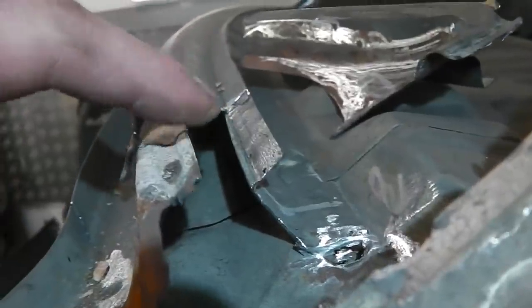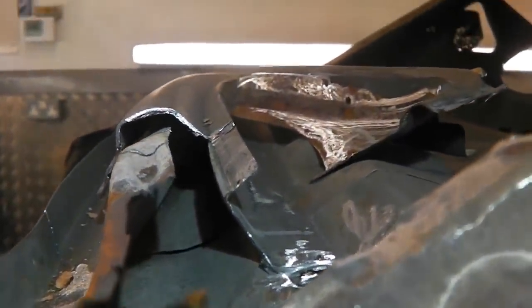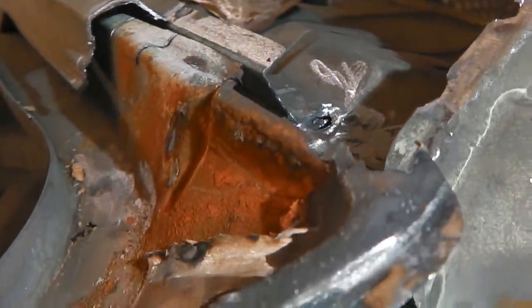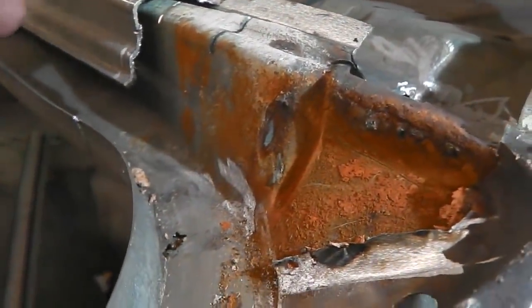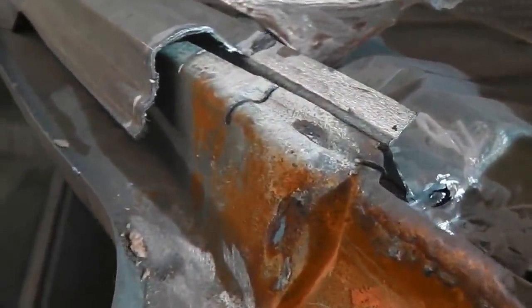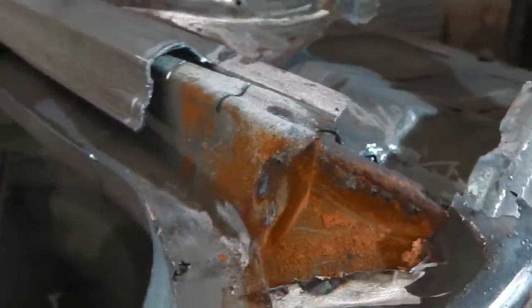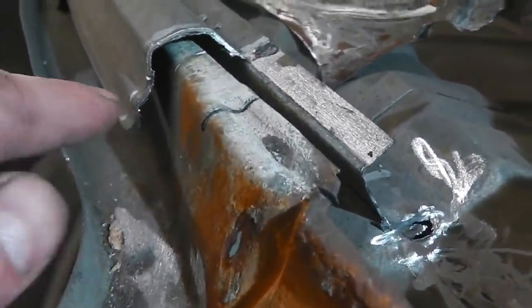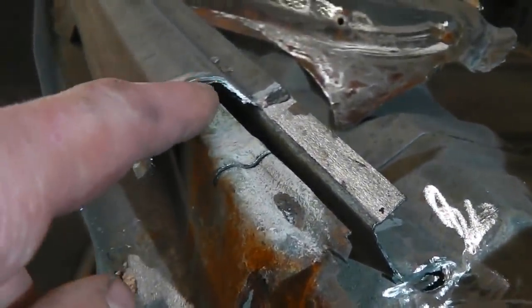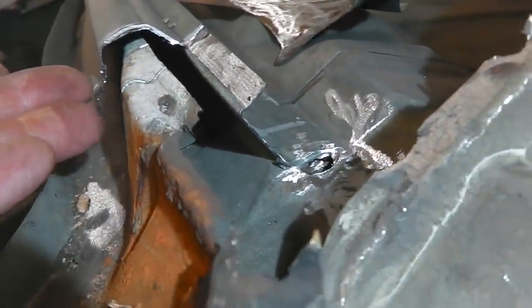So it's creating a barrier between the inside and the outside of the car. Can you see? So it's a baffle, and it's going to probably stop water from getting in. If water's landing in this rain channel, you don't really want it to get drawn up into that. Although the air pressure is actually going the opposite direction, it could still have possible water ingress without having this kind of dam wall, if you will, with the gap at the top. But we can understand that.